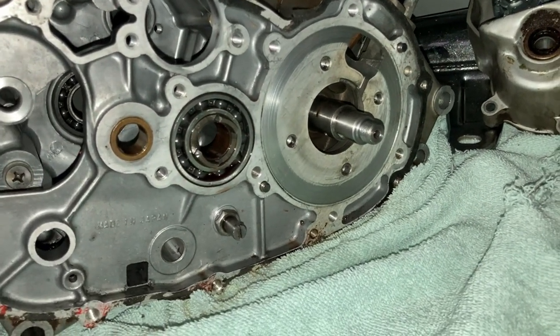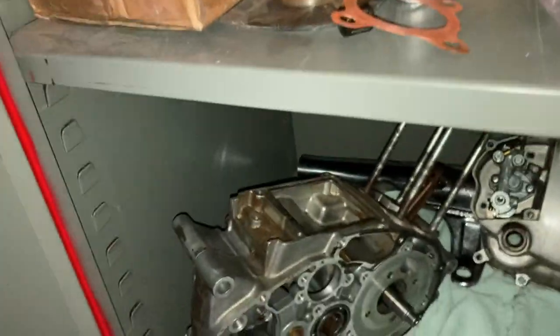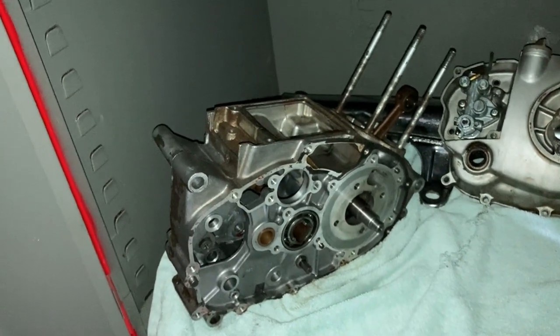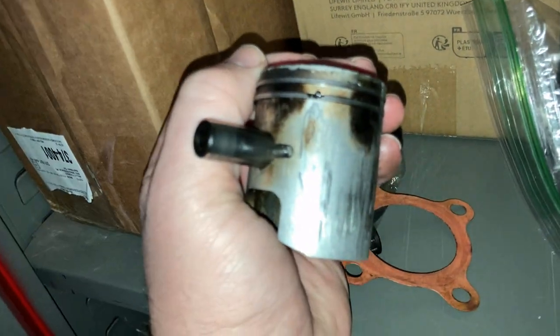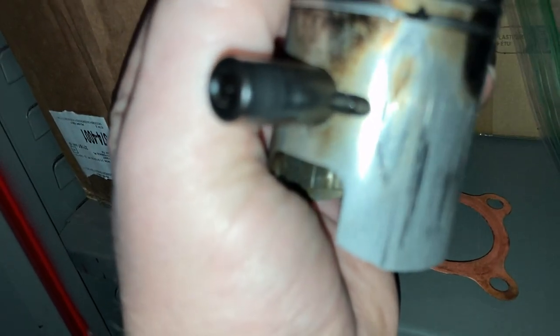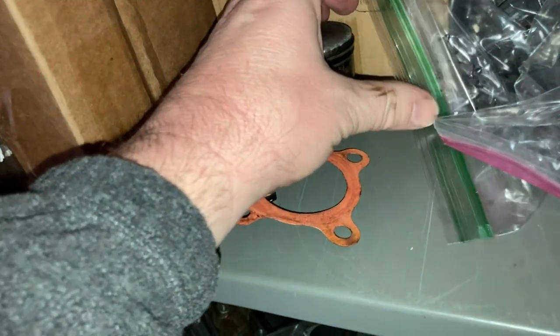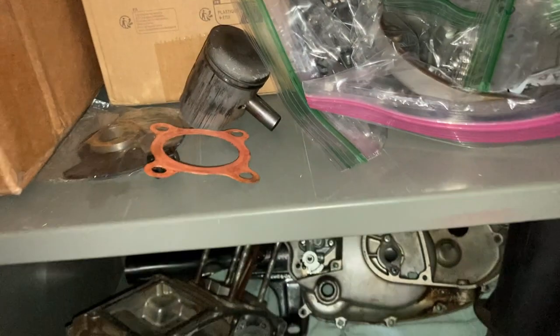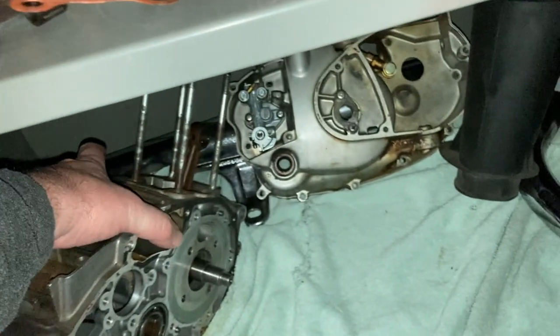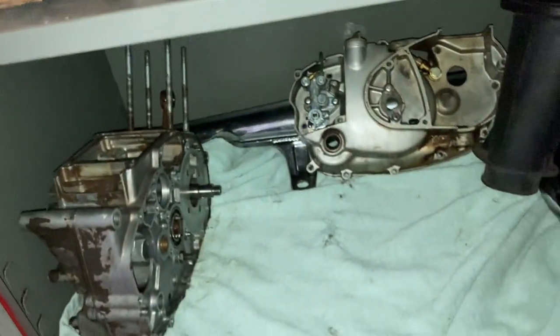This is another project — my dad and my brothers are helping out and I'm purchasing parts, kind of piecemeal. Trying to find a stock bore cylinder for it. Here's the piston — it's not supposed to look like the Grand Canyon. That's the intake side; you can see the aluminum just peppered that poor thing. The exhaust side had some scuffing — probably 50 years of riding. It may have seized up at some point in its life before. This could have been something just happening over time. Really sad.